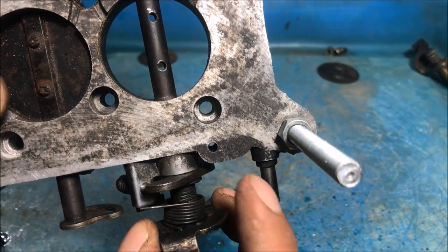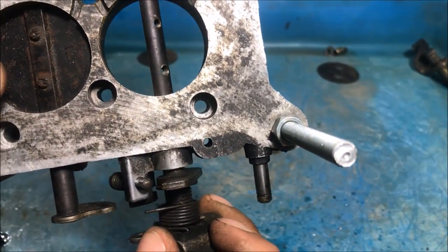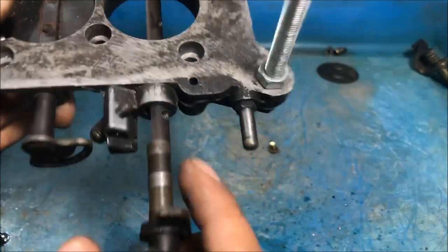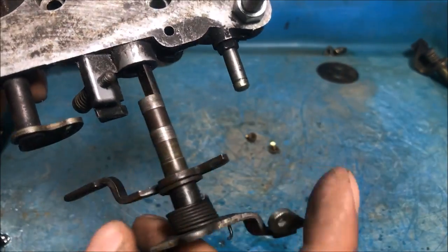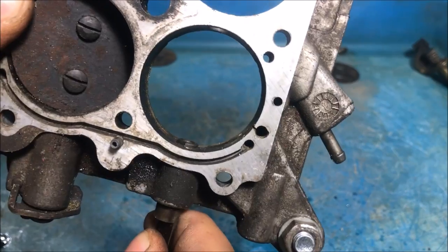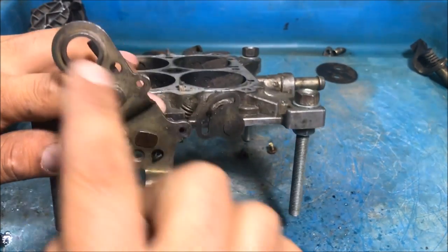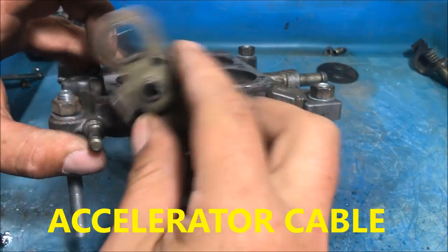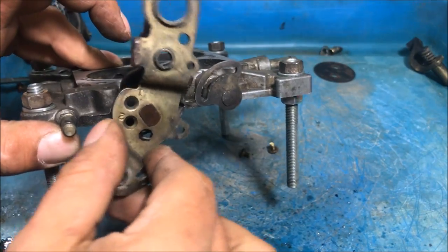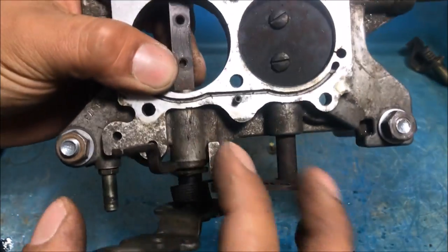This is a very common problem — you can see where the throttle shaft is loose. This can cause problems like gas dripping out and the biggest problem is a vacuum leak. Holley says if you've got more than ten-thousandths play in there it needs to be replaced or re-bushed. This one clearly has about 25 thousandths of play — it was the worst one I had. This is aluminum and obviously this wears out. The wear always happens right here on the aluminum, never on the shaft itself. People say it gets loose because the spring and accelerator pump are constantly battling both ways, grinding on that aluminum.